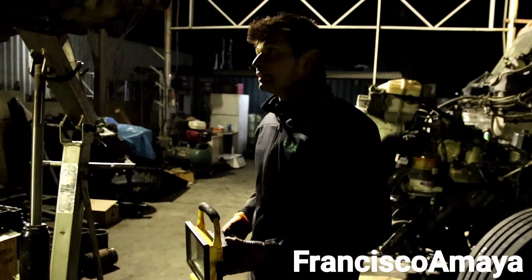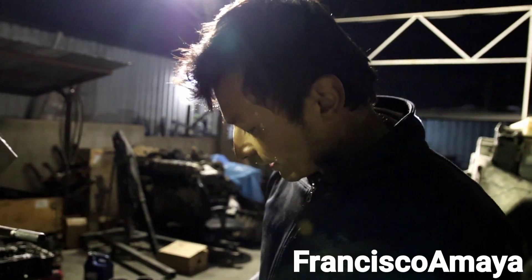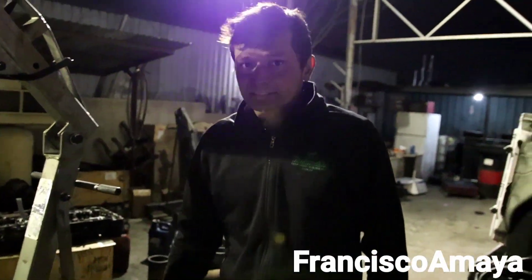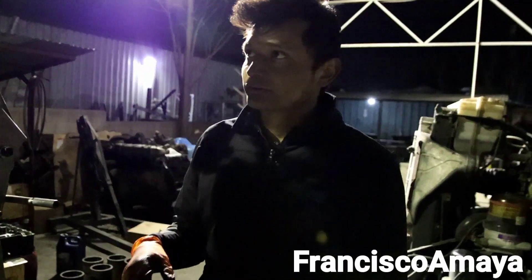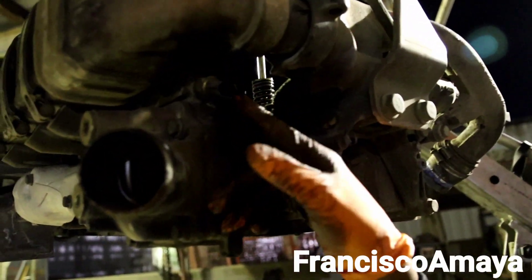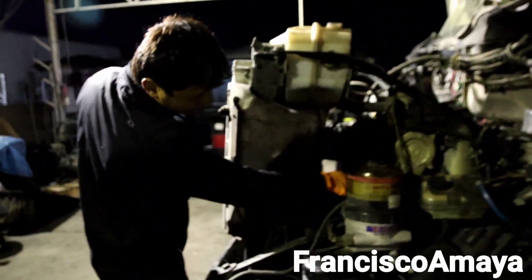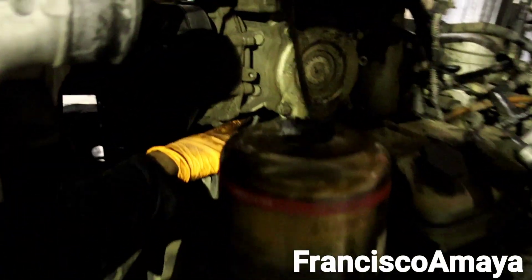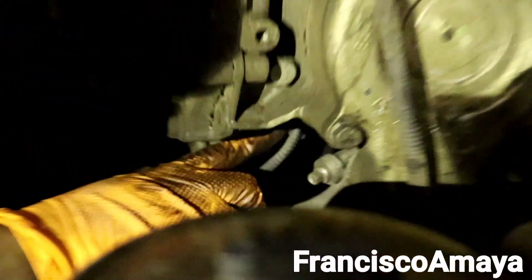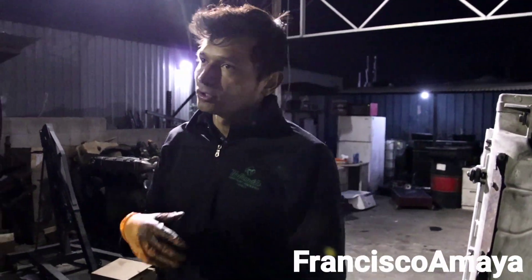It ran for a long period of time and overheated. In the case of DD-15 engines, DD-15 engines have two coolant temperature sensors. They have this coolant sensor right here — the one I'm touching — and they have another one that goes right here. So they have an inlet and an outlet temperature sensor.